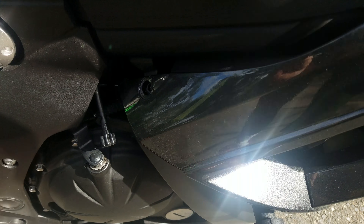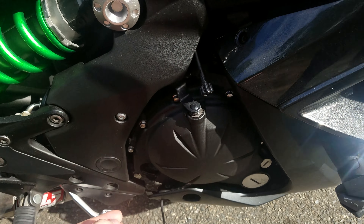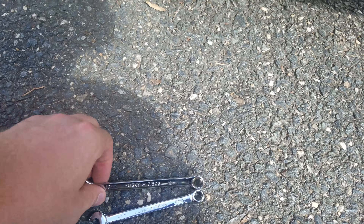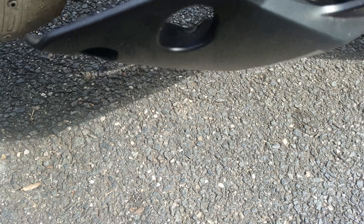You can see it right there. What we're going to need to do is take off four bolts on the right side fairing — the non-drive side of the bike. You don't have to fully take the fairing off, just take those four bolts off and pop it out a little bit, and that'll give us access to the adjustment.